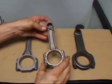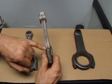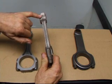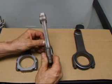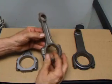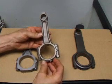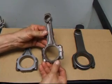This is a typical forged rod and if you look at the parting edge you can see how it's thick, and that's from the forging dies and the forging process that leaves a little bit of material behind on both sides of the connecting rod. This is what you might find in a small block Chevrolet.